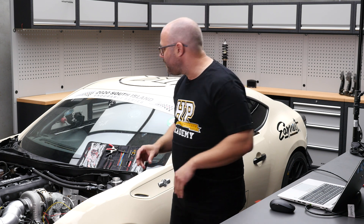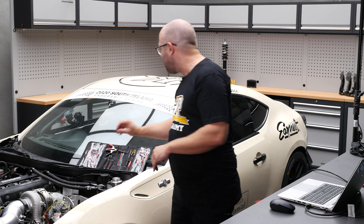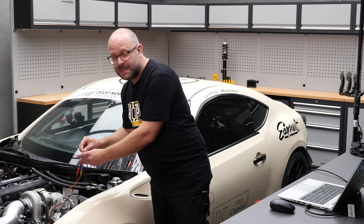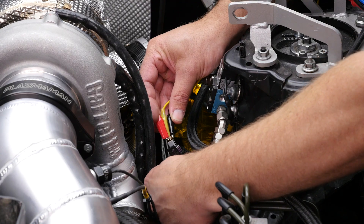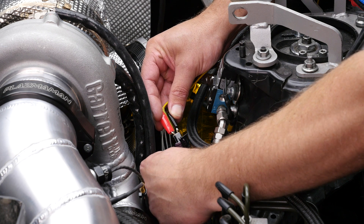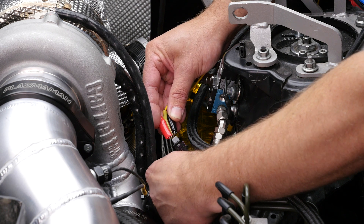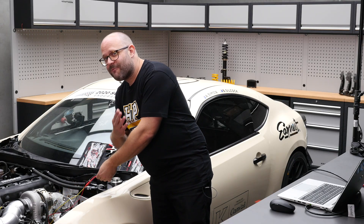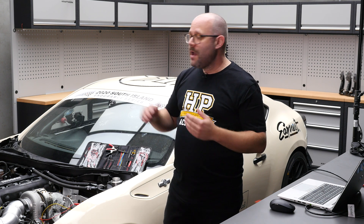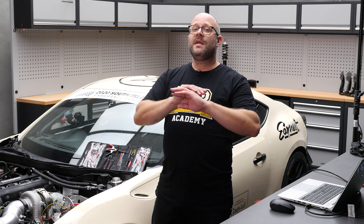The way I've physically set this up is I've got my electronic test toolkit here, which comes with a really nice potentiometer in a case that has three output leads — the upper, the lower, and the middle of that resistor bridge. I've been a little rough and ready: I've got some spare connector pins plugged into the wiring harness and just used alligator clips to connect everything together.